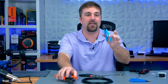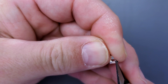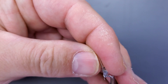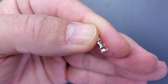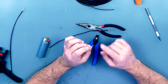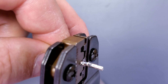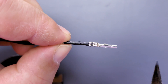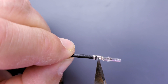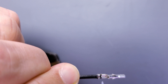Well, we have to mod the pin — it's a mod. I get these little tin cut snips, or you can use your standard side cutters, and what I'm going to do is just cut off just this much of the end of the wing. That's now just enough to let the wings bite into just the insulation and not deform against the solid copper core. And you can see that first set of wings crimped into that solid core really nice, and the second set of wings just wrapped around and was just able to bite into the insulation without deforming around the wire.